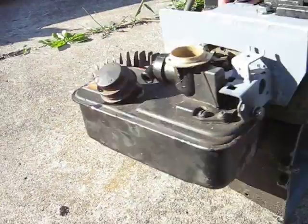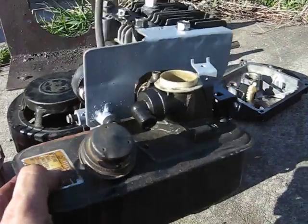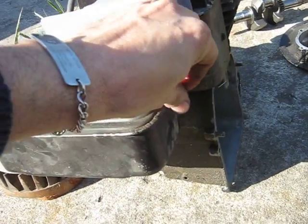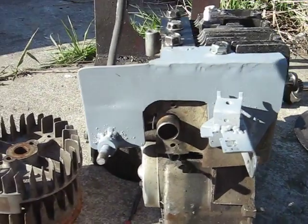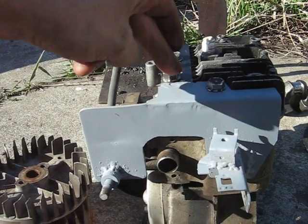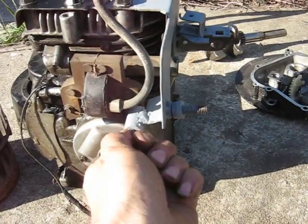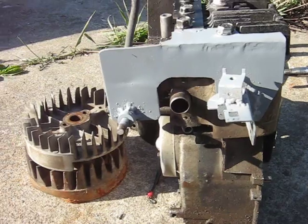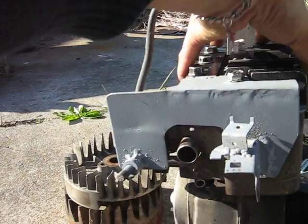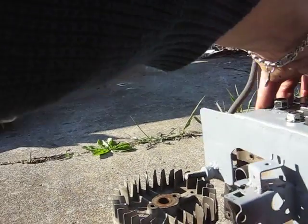Next was how to mount the gas tank. I just rotated it 90 degrees from where it used to be by building a special bracket. There you can see the bracket — it's welded to the cut-off part that normally holds your throttle linkage, mounted with four head bolts, and I also made a mount on one magneto bolt for steadiness. The gas tank slides on one bolt under the intake manifold and uses one bolt at the front. I also welded a part on there to hold the throttle cable since we're using it as a go-kart.